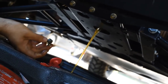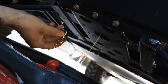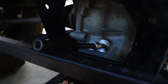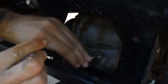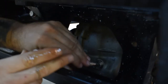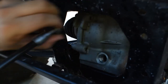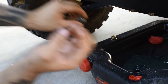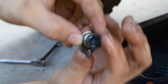You're gonna pull this plug out and let it drain. Then go up to the top where the fill plug is and take it out — there's plenty of air in there. Make sure you clean around the fill hole; this thing was pretty dirty. If you do what I did and set them both right next to each other, the fill cap has an indentation in it. The drain cap has a magnet — we're gonna let that drain and check it for metal.